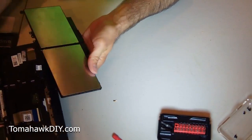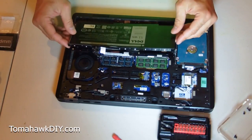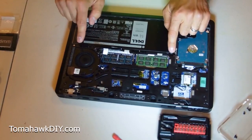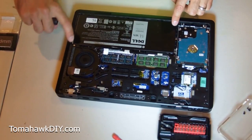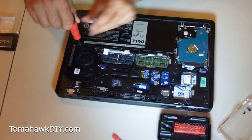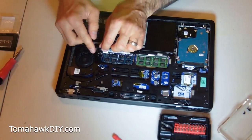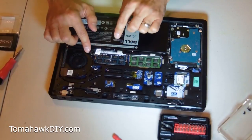Be careful you're not applying pressure where you don't want it on the battery. Now you're ready to put your battery back in. Remember how this thing came out — you've got a side here that slides under. Watch your cords. It kind of clips back in place like so. We've got two screws. Be sure it's flush all the way around; it was kind of stuck up on mine when I first put it in, and that'll cause problems when you try to put the cover back on. Put the screws in loosely first, then tighten them down. Now I'm ready to reconnect my cable — checking for the alignment of all the pins. Once it's aligned, down it goes.